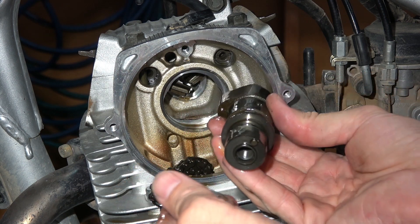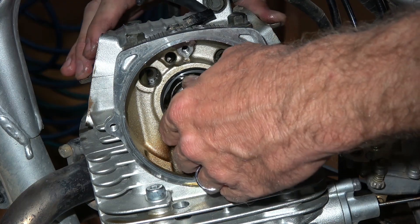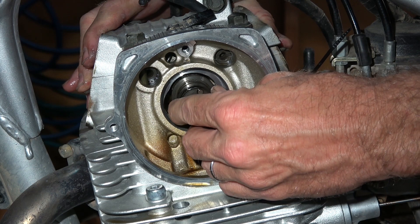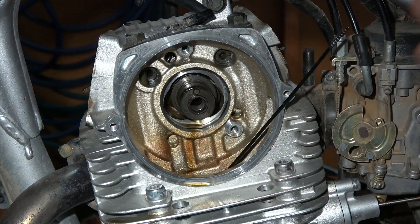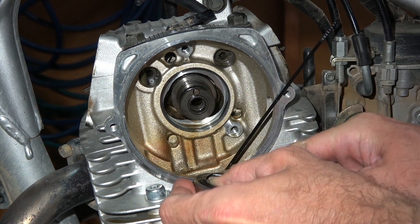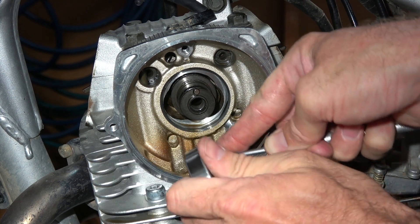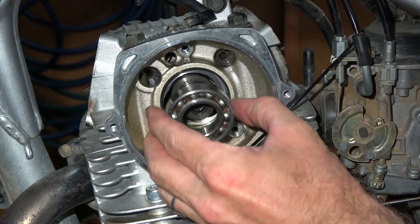This is why I'm replacing mine with a ball bearing, even though this one doesn't even have a problem with oiling the head. I'm putting my hand around the other side of the bike, pushing down on both lifters, and then the cam goes right into place. The pin goes approximately in the up position. Removing the seals is pretty easy — just get a pick or something sharp.